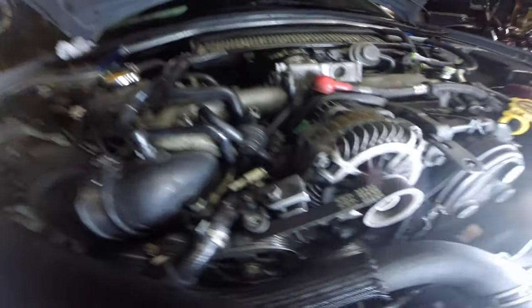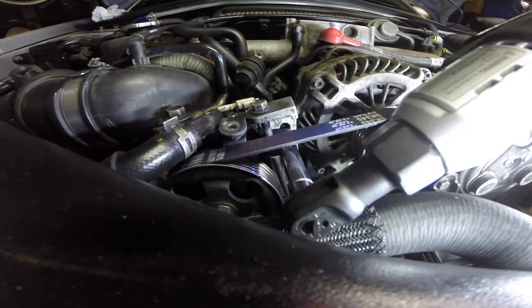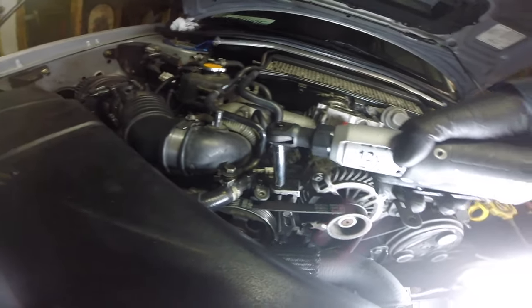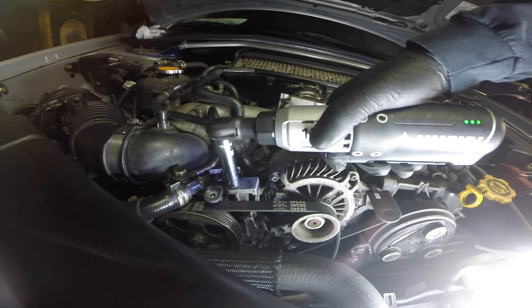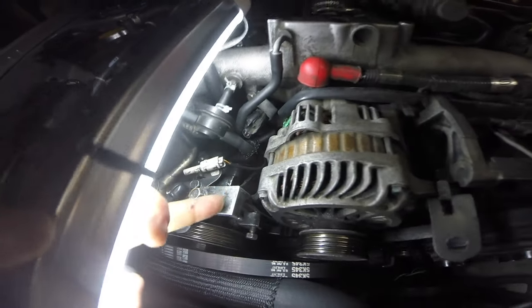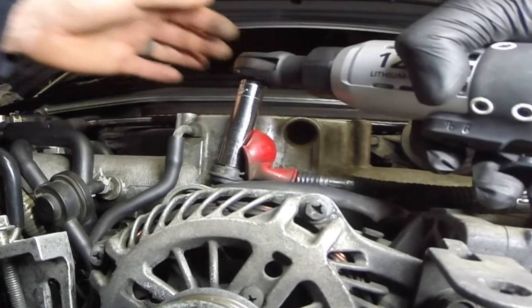I'm just going to remove a couple of 12-millimeter bolts. This one under the belt is the locking bolt — loosen it up a bit. Over here is the pivot bolt, so just make sure that's a little loose — don't have to take it out. Then this is where you back this thing all the way down; this is where the ratchet really comes in handy. Now that the belt is loose enough it should just slide off, and then we back out the whole screw to release the alternator on that side. Then we'll just have the pivot bolt with the bracket for the alternator cover.